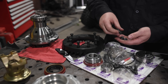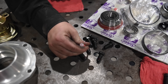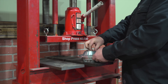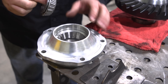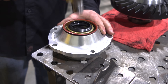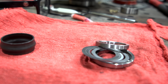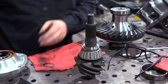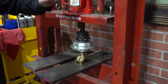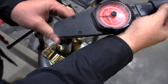The first step to building a nine-inch third member is to press the side bearings onto the locker and bolt up the ring gear. The bearing races can then be pressed into the pinion support. You can drop in the secondary pinion bearing, add a little bit of silicone, and install the seal. From the factory, the nine-inch uses a crushed sleeve for pinion bearing preload, but I prefer to use a solid spacer with shims. I just start with a guess on the amount of shims needed, assemble the pinion support, and then press the yoke on using the press. I'll then check the rotational load on the bearings using an inch-pound torque wrench — in this case it's just too tight.